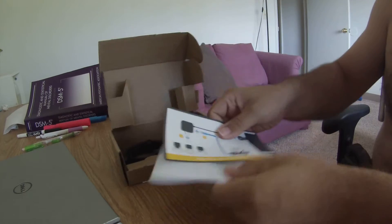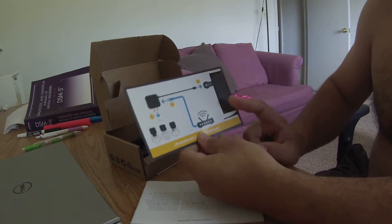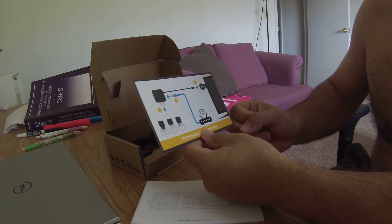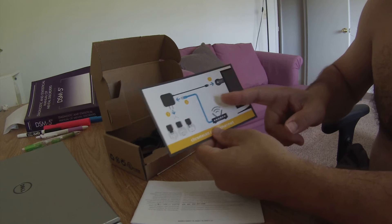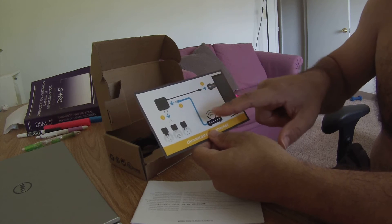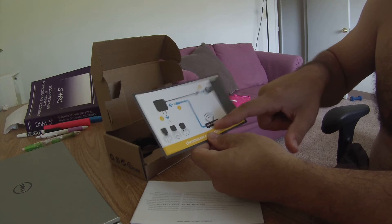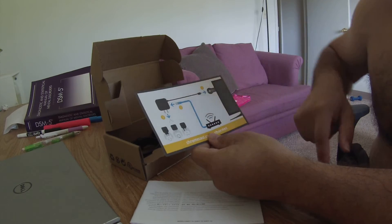You get the instruction manual on how to plug it in. I did a previous video about having issues where the Chromecast Ethernet adapter wouldn't connect to Ethernet for me — no matter what I did, it just wouldn't work. It's because I didn't follow the directions to the T. You need to follow the sequence: plug the Ethernet adapter into the Chromecast, plug your Ethernet cable from your router into the Ethernet adapter, and then plug the adapter into the wall.